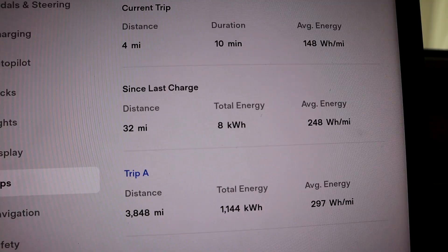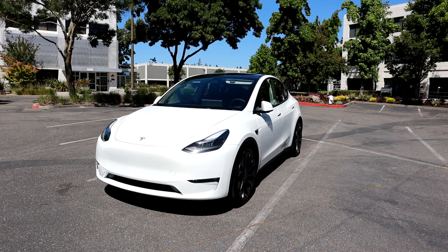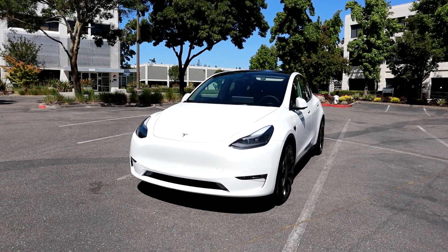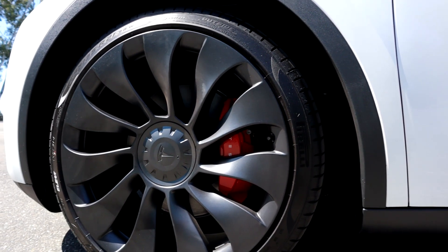That's really all there is to it. Accelerate slower, then just cruise and drive like normal, and you'll be in the 250 to 270 watt hour a mile range. I know it's getting colder now, and you might think that's why efficiency is better, but I've been testing this for a bunch of months and even on days when it's 80 to 85 degrees out, I can still get 250 to 270. So it's really a lesson in discipline — if you can't keep your foot from smashing the pedal, put it in chill mode and get that better efficiency.